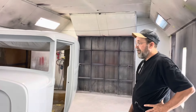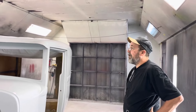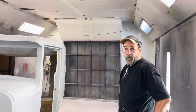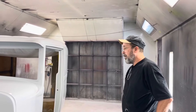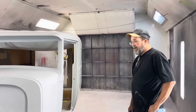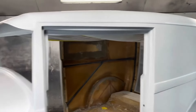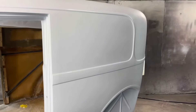I'm going to get it all wiped down, get the doors wiped down, and then we're going to inspect it real close after we clean it — make sure there's no pin holes or anything. We've got some new tack rags here. I had your activator in the other building; I brought that all back, so you've got all your materials here. Now we're ready — it's ready to get painted. Got some racks for the doors to get them painted at the same time. Sealer is on next.